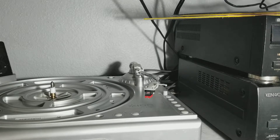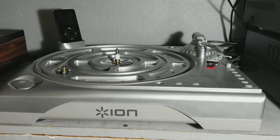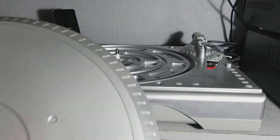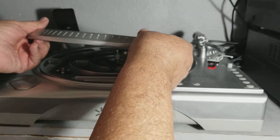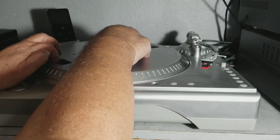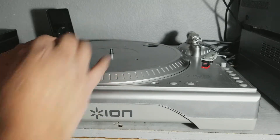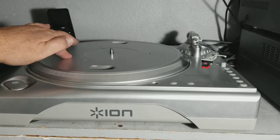Then let me show you how you put your platter back on. You basically wrap the rubber around the inside loom of the platter so she sits like that, and you kind of stretch it out right in the hole — you have two. Then what you're going to do is put that band over this pedestal here — the capstan, that's your drive motor. This is a belt-driven turntable. You drop it down, push it — you just put a little bit of force on the LP to get that platter to sit evenly. Then you let go of the band. Voilà.